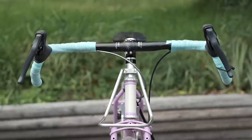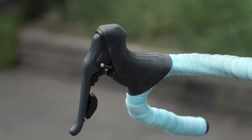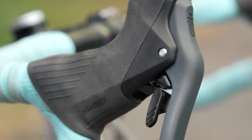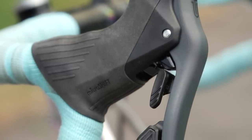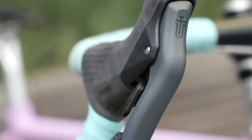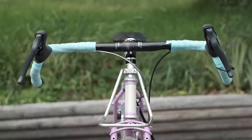You'll notice also that the routing now goes under the handlebar tape. This was a big sticking point with older Advent X brifters that had the external routing. Now it goes under the tape — super nice and clean, a lot easier to put your bag on the handlebar. Another interesting change is the pivot point: it's moved a little bit lower, providing for greater cable pull. Using it with the disc brake in the front and a cantilever in the rear, it just feels great — really easy to get strong braking from the hoods as well as the drops. I think these have to be the best non-Shimano, non-SRAM brifters I've tried personally. It would be awesome if they just did a plain left and right brake lever for people that want to do weirdo bike builds. In terms of ergonomics, aesthetics, and braking feel, it's an absolute win — feels like a quantum leap from the previous brifters.